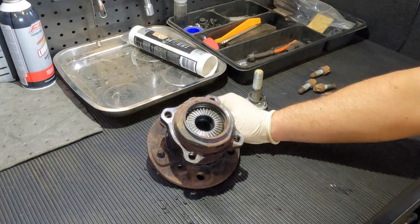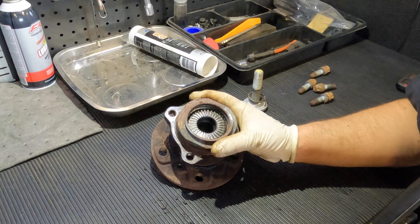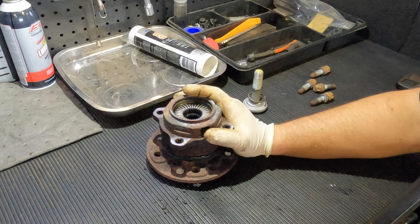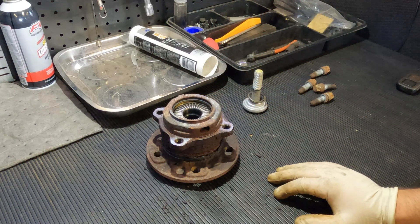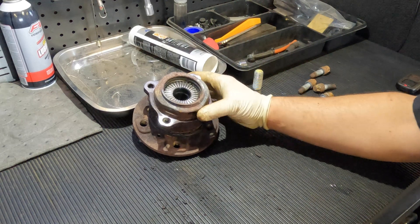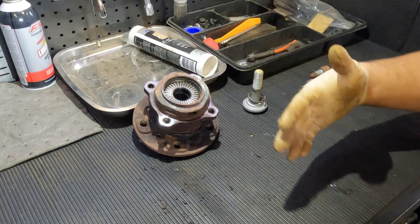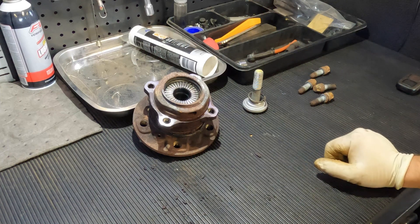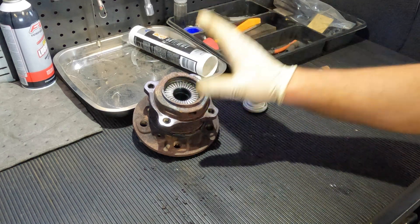It wasn't horrible, just a little bit more nerve-wracking if you're not used to it. This design, even though it's about the same, is an interesting new design. You can't really knock it too much, except I don't think it'll hold as much power as the old school stub shafts with splines — that's where I'd want to go with the more tried and true method. If I was a tech just replacing axles, this would be a dream, because you don't have to remove the wheel bearing or loosen the knuckle to get the axle out. But everything else has disadvantages to it.